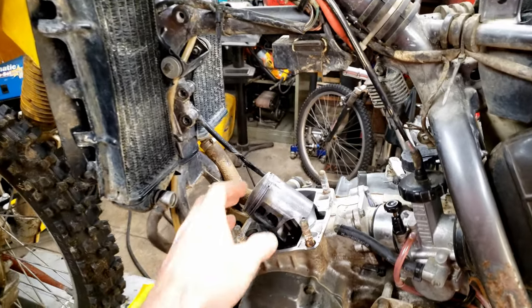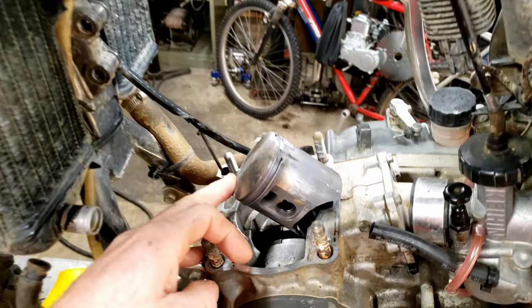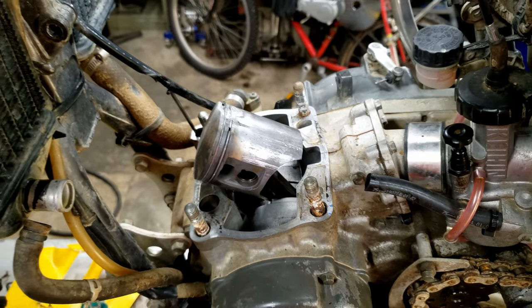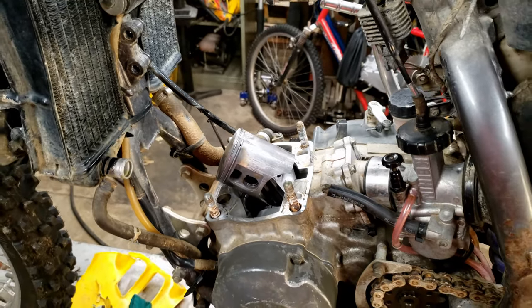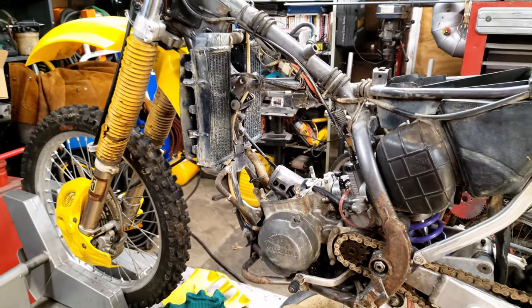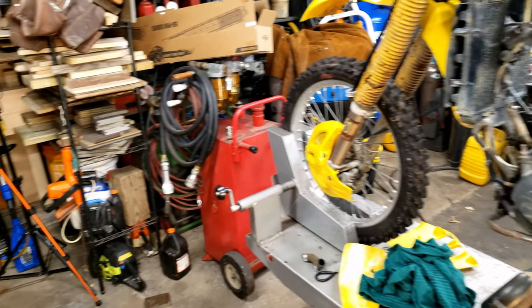But normally when you see something like this, you'd want to pull the whole engine out, because there is metal debris that gets down underneath into the bearings and such, and that's really the way to go. But he said, put this thing back together as cheap as you can, just get it running, right? So anyway, that's where we're at.